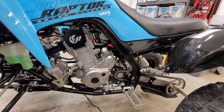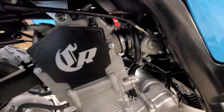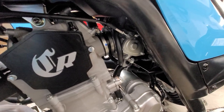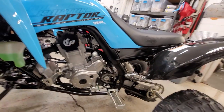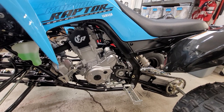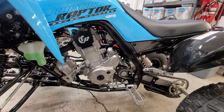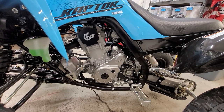But the plus one head package is ported and works with our OEM factory bored throttle body. So we upsize the factory throttle body 3mm, cut down the plate, or cut down the shaft and put a new plate in there, and punch those out as much as possible to give us as much flow as possible.